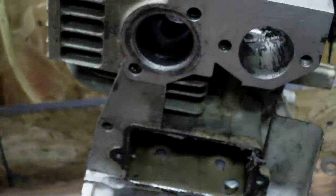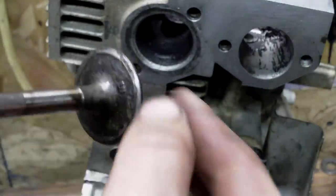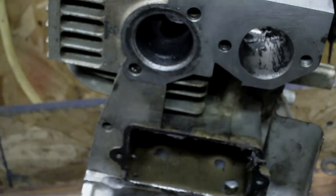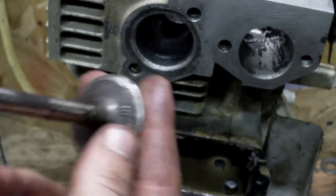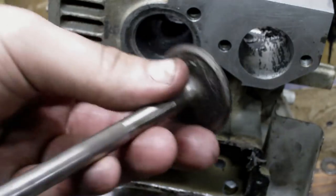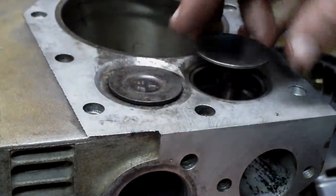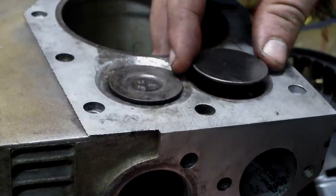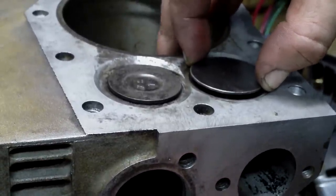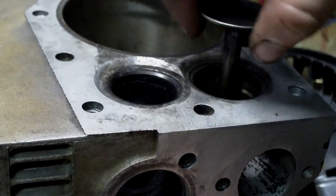Notice this valve is burnt. Looks like it's burnt right through here — there's like a little tiny crack in the valve right here. The valve seat is fine, so I got a valve out of another engine. If I put it in there and re-seat it, it should be fine. We'll check the valve guide play here in a minute. I got the valve sitting in here — this is the original exhaust valve, and this is my old intake valve I'm putting in. This is how I check valve guide play: get it close to closed and just wiggle it. See, it's just barely moving — I'm not that worried about it. If it's much worse than this, it has to have new valve guide bushings put in, and that's getting into a little more work.